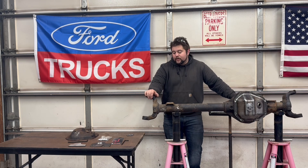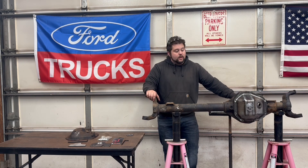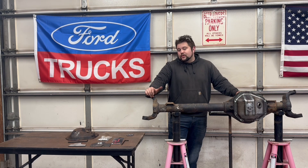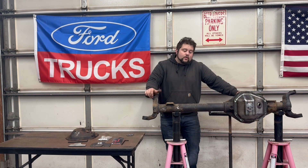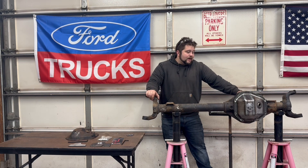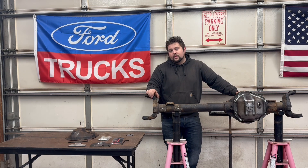On price: while you'll spend money on seals and miscellaneous parts, the real money is in the kit — it runs about $450 or so. That's a lot, but consider what you're getting. A normal diff cover like a Rough Country runs $150–200. So you're really paying about an extra $250 for the custom diff cover and the bottom plates, giving you an extra inch of clearance for around $250 — pretty good compared to pricing out tires two inches bigger. It makes the most sense if you already have the axle out and are re-gearing and putting in new axle shafts anyway.